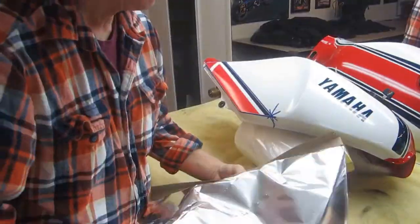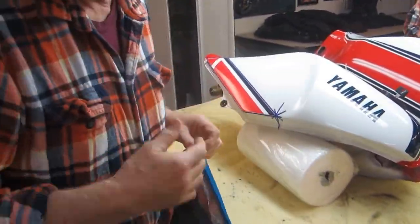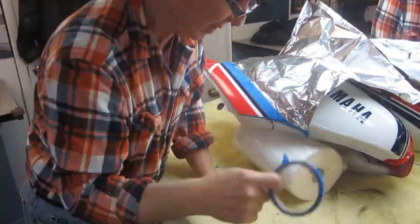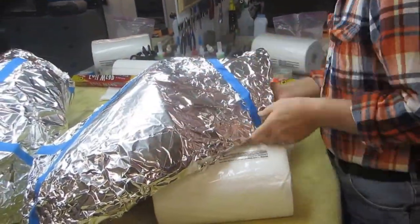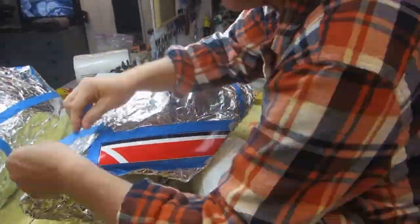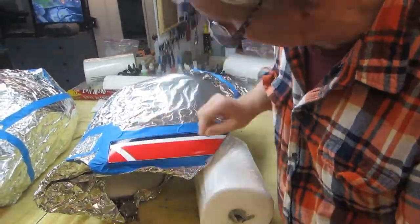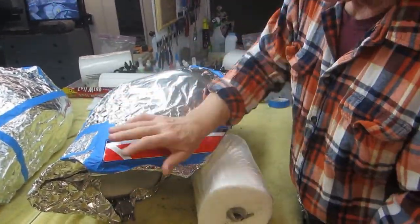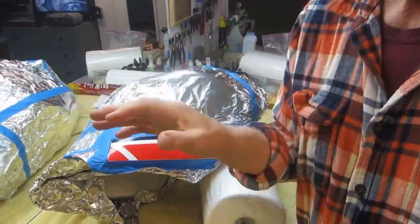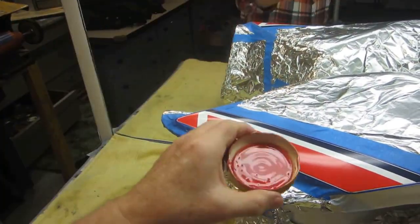The next step was to very carefully back mask the whole tank, leaving that tape about a 64th of an inch up to try to avoid that step where a decal would end and the no-decal area would begin. I used the tinfoil method that was shared with us many years ago by the late Walt Prey, custom car guru in California — that always seems to be a good way to do this. We're working around some crappy weather and won't be able to paint today, so I got everything back masked and prepped up, ready to go as soon as we get an appropriate day to spray clear.